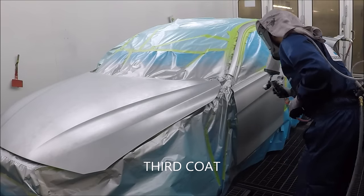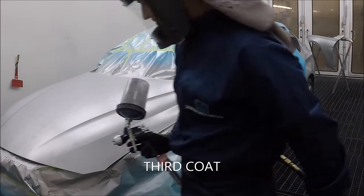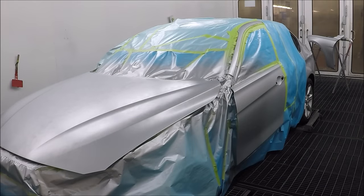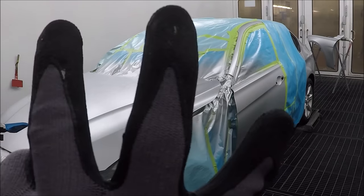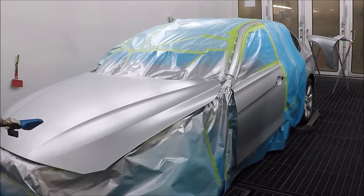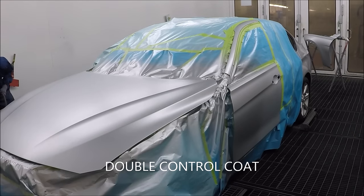As you can tell with my blend there, I'm angling it in a way that it's going to be easier to blend, easier to lose it. Because your eyes always want to look for problems. Your eyes always want to look for what's wrong with something. So if you angle it like that, you will trick your eye, and it'll look better. You obviously have to lay down a good blend. You obviously have to make sure you're keeping the color contained.